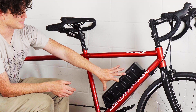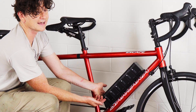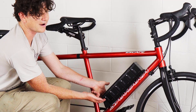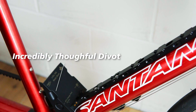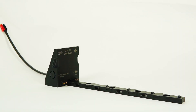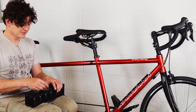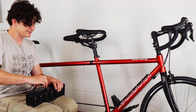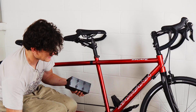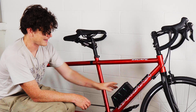In some cases, especially with six LIGOs fighting gravity and the friction of the connector, it can take quite a bit of force to slide the LIGO pack forwards. There are little divot indents on the dock so that you can get your finger behind the back of the pack to give some assistance when sliding it. You'll also notice there are many more spring latches on this rail than just the leading one — that's to allow you to use smaller groups of LIGOs even though you have a larger rail. So if you only needed three LIGOs for a shorter trip, you can just as easily slide on a three-stack LIGO and the lower latch holds the battery in place.